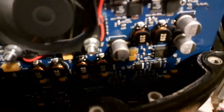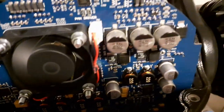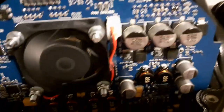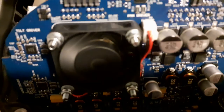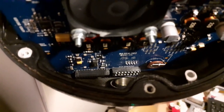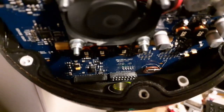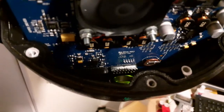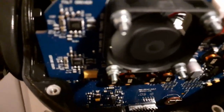There are the lamp controls for the infrared — this is the IR infrared model. They do make one with... this is also the 30x zoom model with digital zoom. Down here I'm not sure where the heater is, but it does have a heater according to the menu. Down there are the dip switches for the address, protocol, and baud rate. This one is currently running Pelco D at 9600 baud rate.